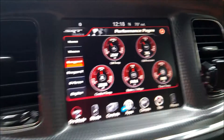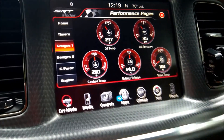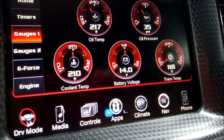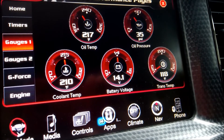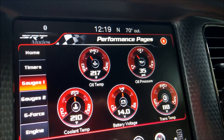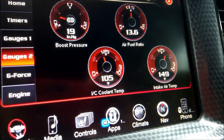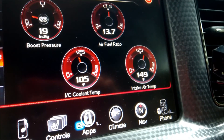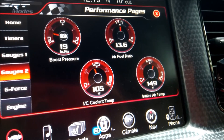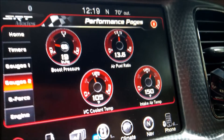Alright, I'm back. The car has actually been running for about 20 to 25 minutes now. You can see from the temperature gauges that it is definitely warm: coolant temperature is up to 210, transmission temp is up to 118, oil is up to 217, and the car is still registering 70 degrees outside. The intercooler coolant temp is up to 105, and the actual intake temperature is up to 149 to 150 degrees solid. The car is definitely pretty warm and ready for a good test of how hot the supercharger actually gets.